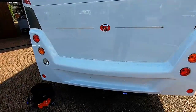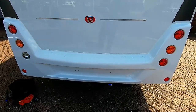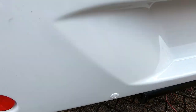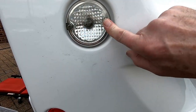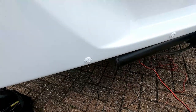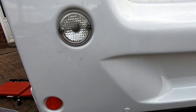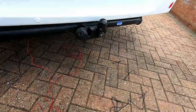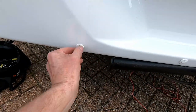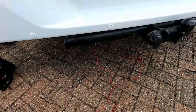So the next thing is to find where I'm going to put the control box and the internal indicator in the cab. I've made the electrical connections. I took the reversing light off and connected to the live wire - the live wire on here is red. Then I connected the negative wire to a place on the chassis where other wires are grounded out. I connected all the wires together - the box and the sensor. I found that I had to turn these around a bit. They did work, but I had to turn them vertically - that seemed to work better in that position.